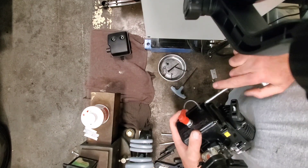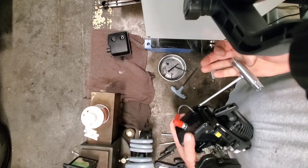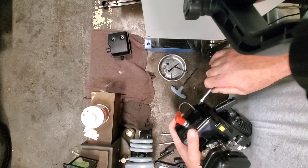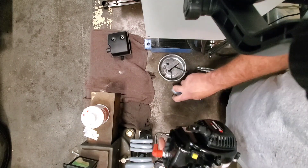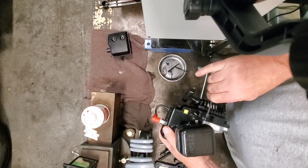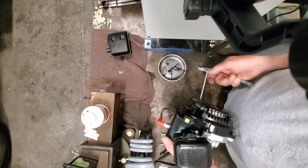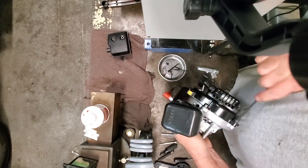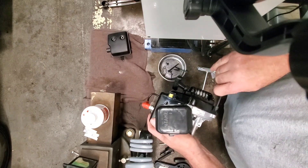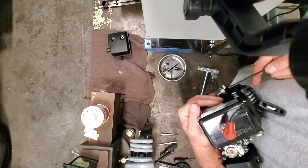The gist of modifying these motors is: one, we're going to try to make it run smoother with less vibration at the RPMs at which we run them in helicopters. That's going to require us to change the balance factor inside the motor. Different manufacturers use different balance factors. The one I like for this motor requires substantial lightening of the piston — we'll get into that in another video. In this video we're just going to focus on the tools you need to tear this little guy down.